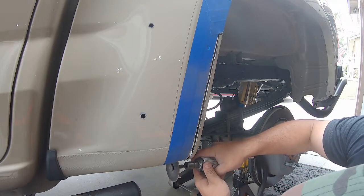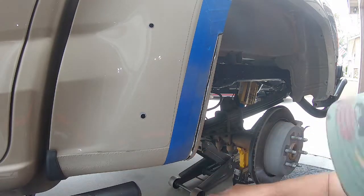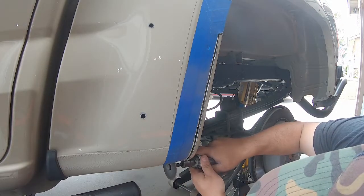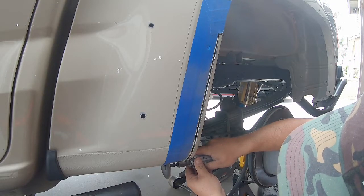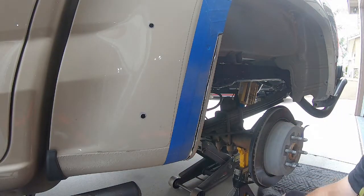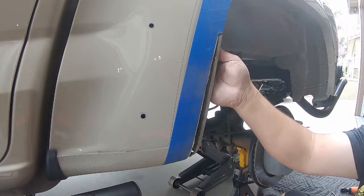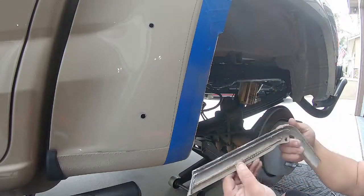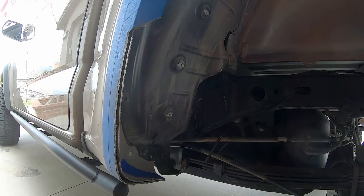Once I get to the bottom, the top is still in place — the vertical and cross lines weren't quite connected to prevent the blade from binding and flinging material when cutting the thicker section. Once it's cut, I go to the top and wiggle the joint loose. Here you can see the two thicknesses of material and what it looks like between the two — this is what we're working with and what we'll clean up next.